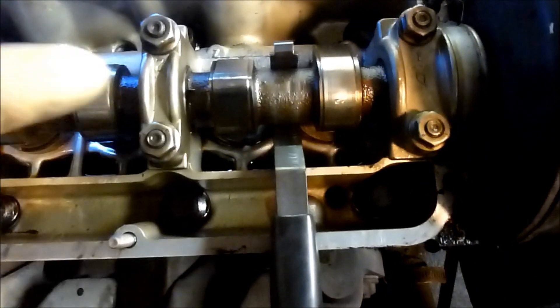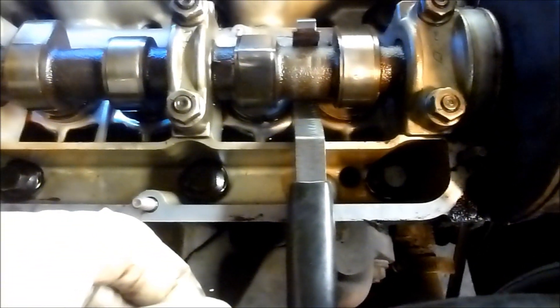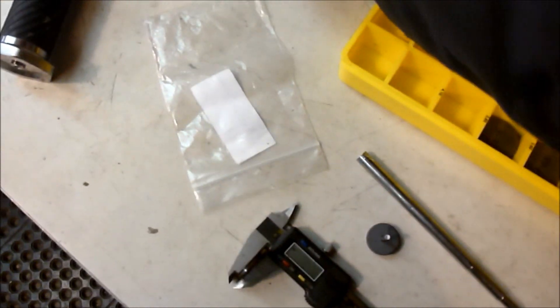You've got to get those little shims out of there. You use this tool — it's just a little hook deal. It compresses the valve springs by using the cam as a fulcrum, and then you can swap out the shims. The shims come in a little kit like this, all different numbers in metric sizes, and then of course you've got to convert by using your handy dandy little tool to figure out what you need.